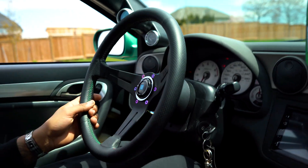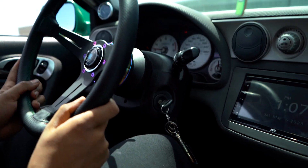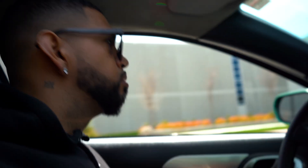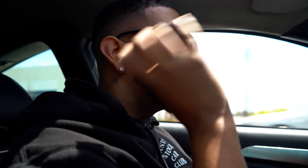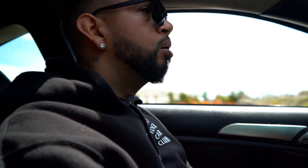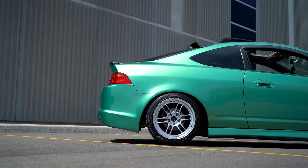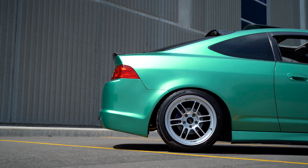Let's go for a bit of a drive. Is the clutch stock? It's actually a Stage 2 clutch with a resurfaced flywheel. From the inside the Jay's Racing exhaust is perfect — you get that nice tone but it's not over-obnoxious. You can cruise at 120 and the drone isn't horrible, and it's not super raspy at all. Do you rub at all on this setup? Daily driving, no — if I hit a really bad bump or come out of a really steep driveway I might rub a little bit. Suspension is Function and Form Type 2s.